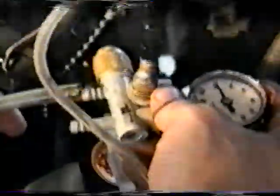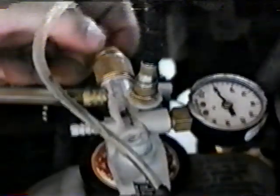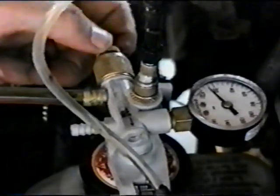Connect a capture container to the relief valve outlet to collect the bladder or system fluid. With the slide valve in the system position, unscrew the relief valve counterclockwise until system pressure reads zero. Any system pressure will be dispersed through the relief valve outlet.